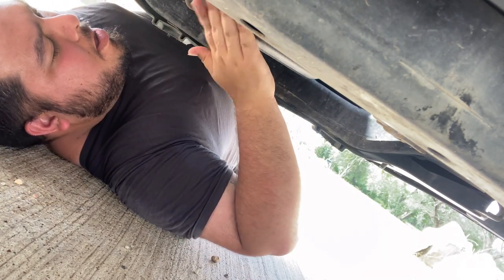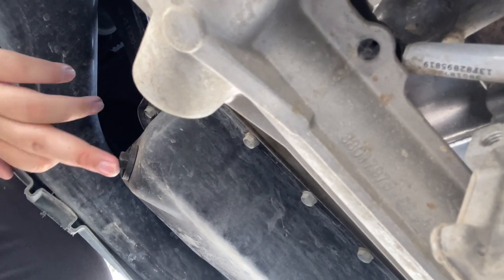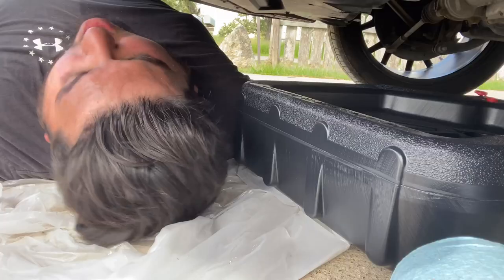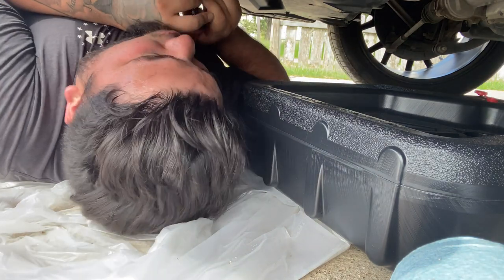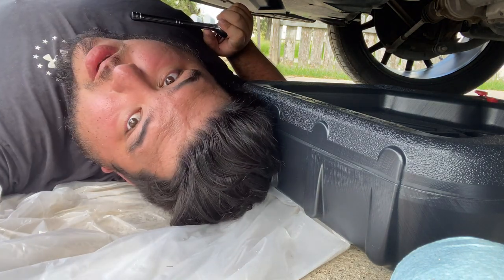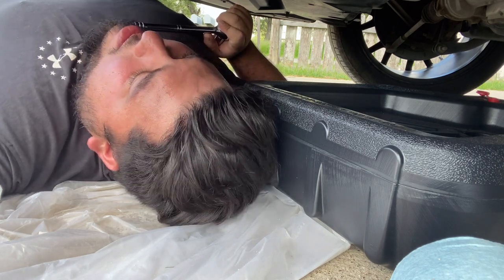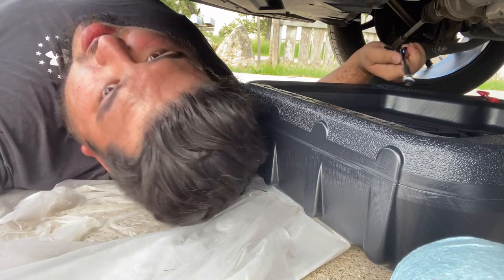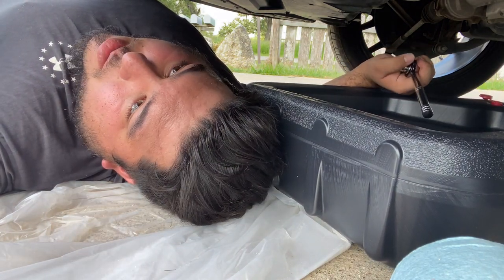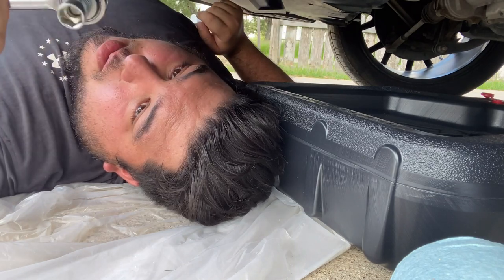Right here is your drain pan — and this is your drain bolt, which is what you'll need to remove to drain the oil. I put down a drop cloth because I'm in an apartment and I don't want my landlord to start crying if I spill some oil on the concrete. I also have a 16 quart reusable drain pan that I'm going to let the oil drain out into. In order to remove the drain bolt, it is a 13 millimeter socket.